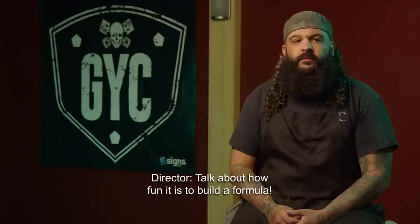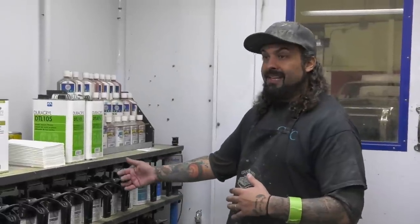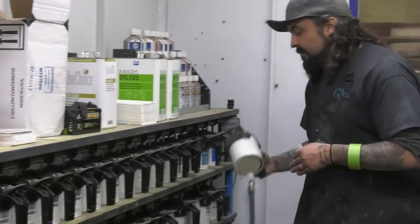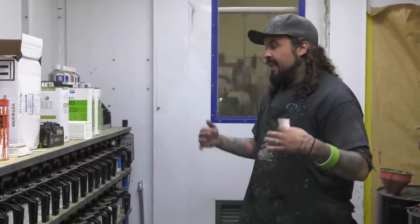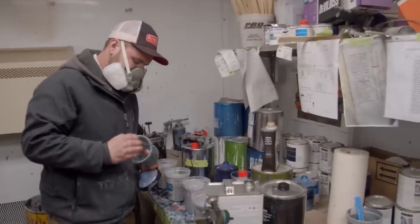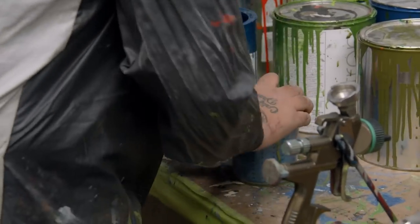One of the problems today is these color formulas are not very accurate. Making these colors is not fun. You go to the computer, print the label for how much you want to make, go into the mixing room, double-check your toners, make sure you have everything — which is hit and miss because it requires so much when you make three gallons. Three gallons is actually six gallons sprayable. You've got a metallic toner, then a second metallic, then a blue, then another blue. You're looking at seven or eight colors between the silvers, blues, and greens that go together just to get B5 blue. When you mix three gallons of color, it takes a good hour and a half.